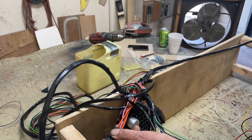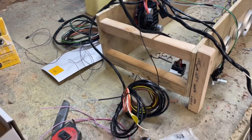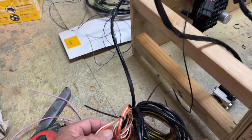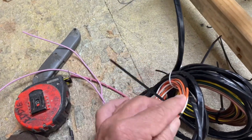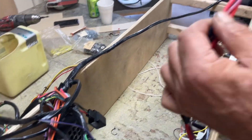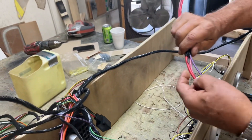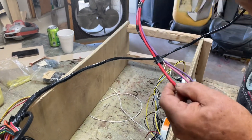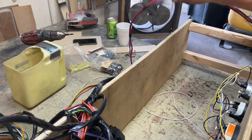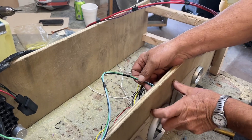It's pretty much plug and play into that for the Sniper. Once you've done a few of these, you know white and orange is usually for the brake switch. These actually say it right on the wires — it'll say 'brake.' And I know pink is usually for the tach. You've got the ignition switch on that one, and then this is for the starter, and that's the main hot that goes into the fuse block. This will go with the starter to the right side. After a while you know all the colors. There are your signal indicators — little lights in the dash for your turn signals.